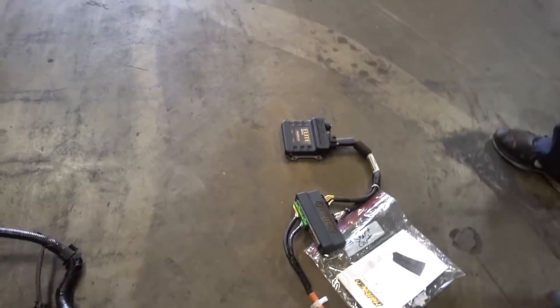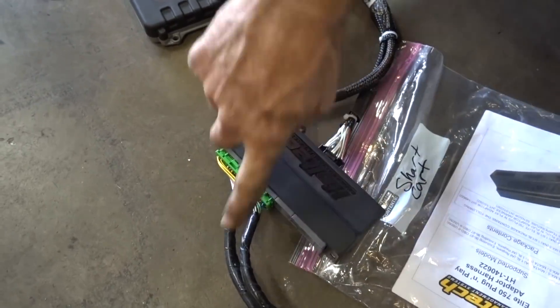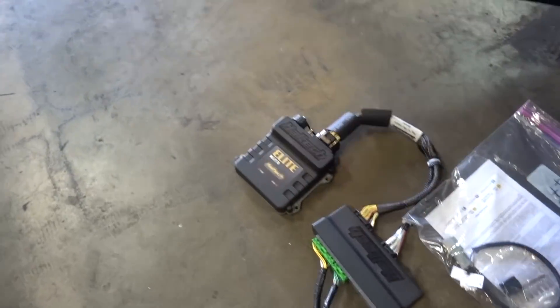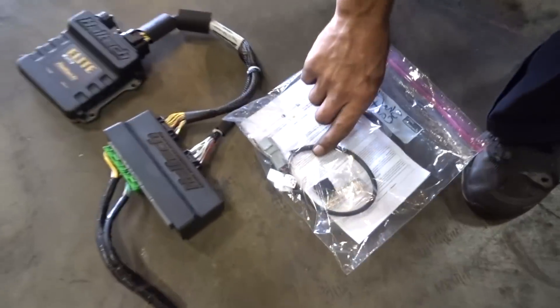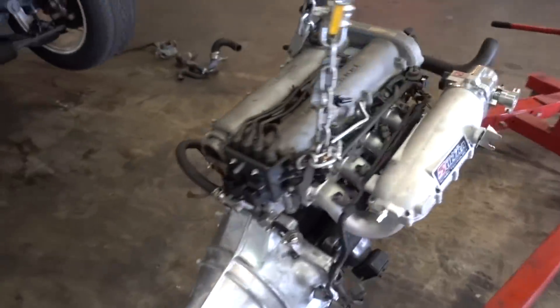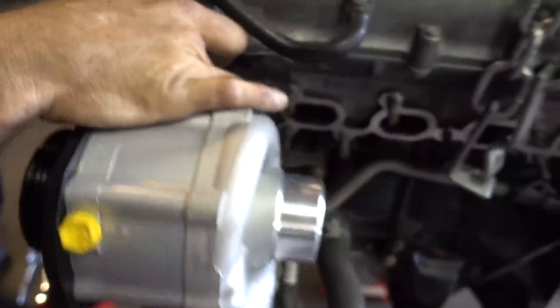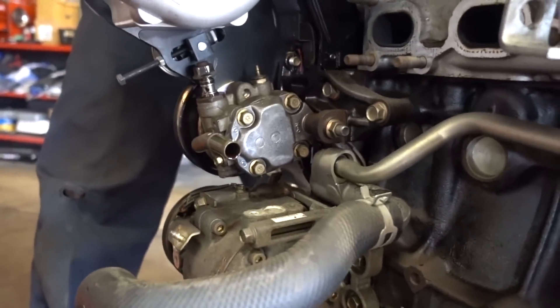Good morning - back at the shop. A little progress on Shark Cart: trans is on, clutch is on, intake manifold is on. The wire loom is basically laid out for the new 1.8 liter - it looks so clean. Haltech came in and gave us their plug-and-play adapter harness. This is the factory wire loom and this is what they made to go to their Elite 750. On a factory Miata you just bolt that straight in, and then we have 16 more pins for all sorts of neat stuff. We're going to put the motor back in - the other factory mounts were ripped so we replaced those with the 1.8 mounts. Main focus today: get the motor in, get the supercharger on it, and get it running. Brad and I mounted up the supercharger - on a factory Miata with A/C and power steering it would bolt right in. Very user-friendly kit.